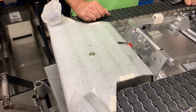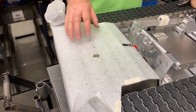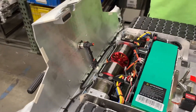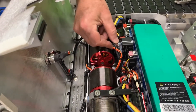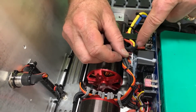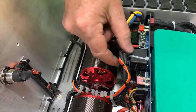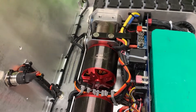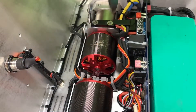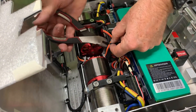Now, this is what you have to do if you're going to remove the cover and replace it with a new one — if you've got a big scratch or something's dented. I'm going to open up the cover and locate the board that has the wires for the lights, the power on/off switch button, and the charger button. These wires are all going to come off with the cover, so I'm going to go ahead and cut these tie straps right here. You've got to be real careful you don't cut your other wires when you're doing that.